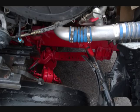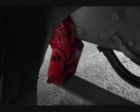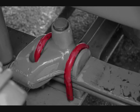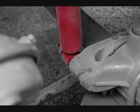Check the right front axle. Check the leaf springs for any missing, shifted, cracked, or broken leaves. Check the spring mounts to make sure they are not broken or cracked, and make sure there are no missing or damaged bushings. Check the U-bolts to make sure they are not broken, loose, or missing any nuts or other parts. Check the shock absorber to make sure it is secure, not damaged or leaking, and there should be no cracked or loose rubber bushings.